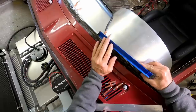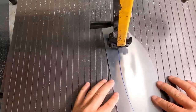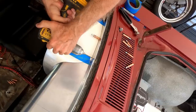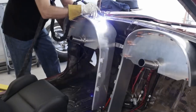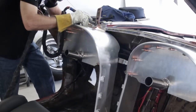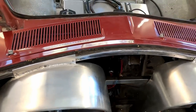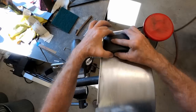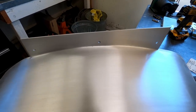If you don't have a plastic contour gauge, get one — super handy. I'll leave a link in the description. I pondered how to attach the mounting flange to the pods and reluctantly chose to weld them. It works fine, but it means a lot of filing and sanding finish work to do afterwards. Doing this on inside corners is laborious compared to outside edges. I guess I could have just used body filler for this.